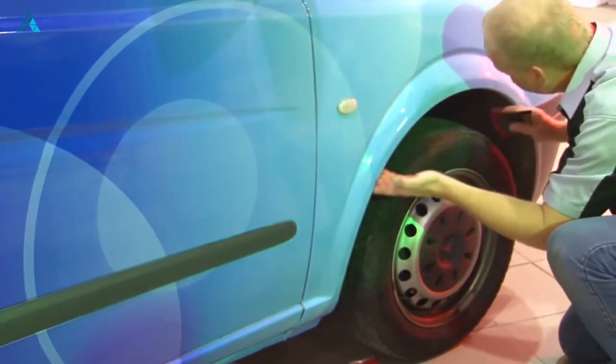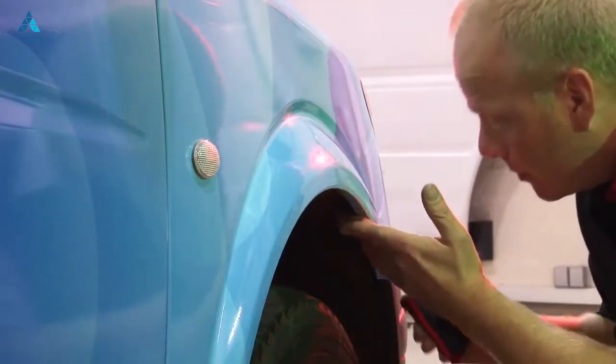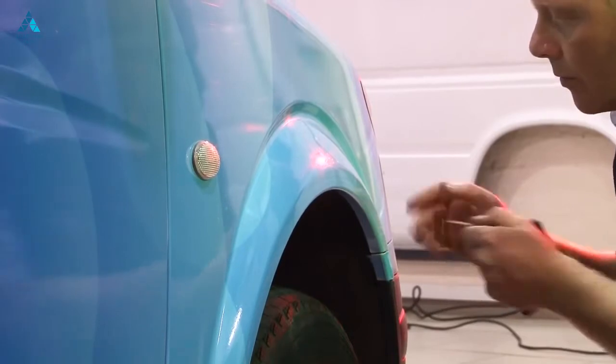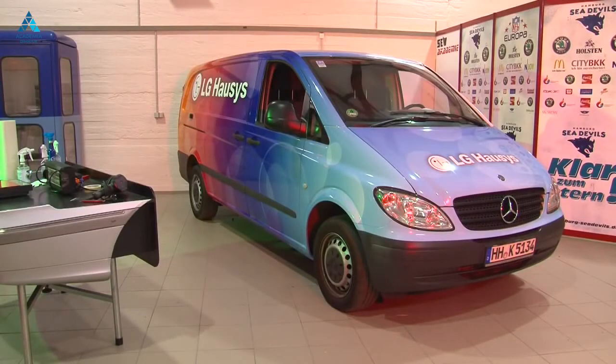You can achieve a more lengthy service life with horizontal exposure of the film on roofs or bonnet surfaces by means of polishing 2 to 3 times using conventional car polish. The first application, however, should be made at least 3 weeks after adhesion at the earliest. Cleaning and a car wash after gluing has been carried out should only occur after 3 days.